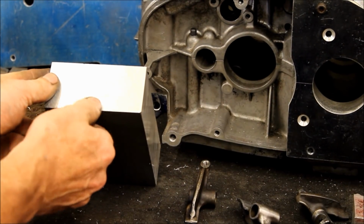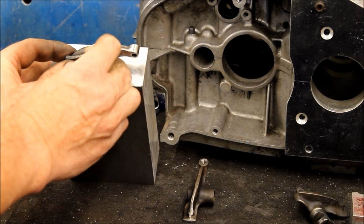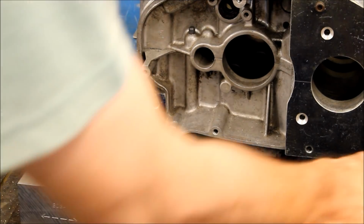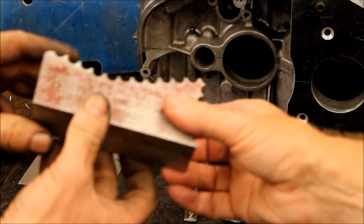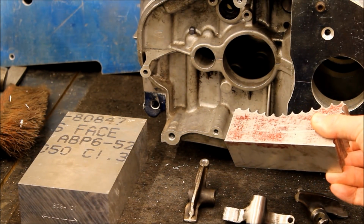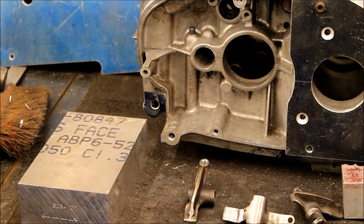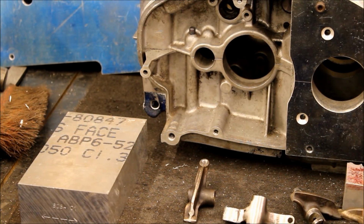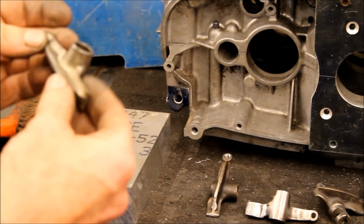And it also has the grain on it as well, because when we put it in, we obviously want the grain to go the length of the rocker arm. Right. So we know we can get 4 out of that. What I'm going to do first, though, is make one as a test piece. I've got a spare head, and I want to keep fitting it in and out just to leave them as chunky as possible. Strong as possible. It's very hard, but also very brittle. That's the problem with them. When they harden them, if you over harden them, they can break.